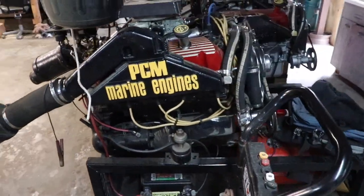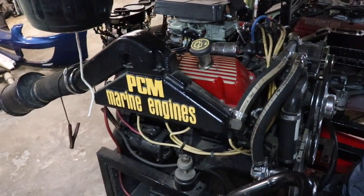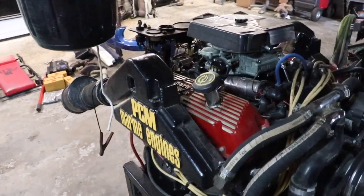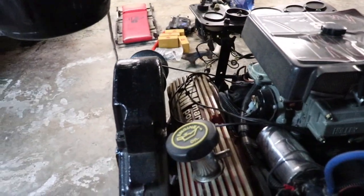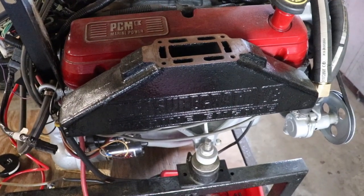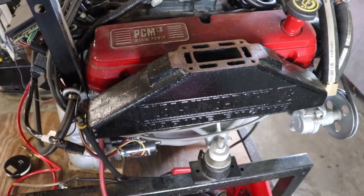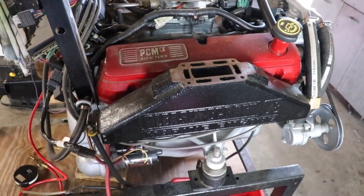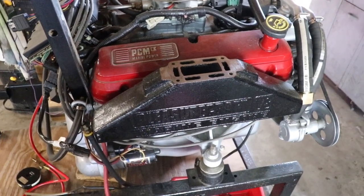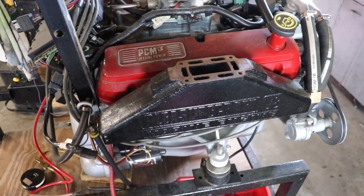We sell a black, silver, I think blue or red spray paint, and those are perfect for manifold, riser combo resprays. The biggest thing is just making sure that all the grime, the debris, any oil, anything like that is off of the manifold, and you can do that by applying a solvent, just rubbing on some alcohol or enamel reducer or something of the sort.